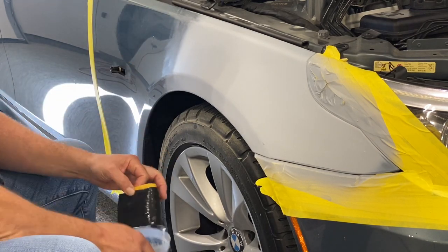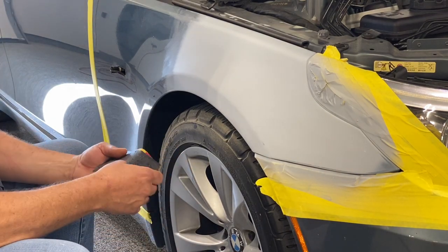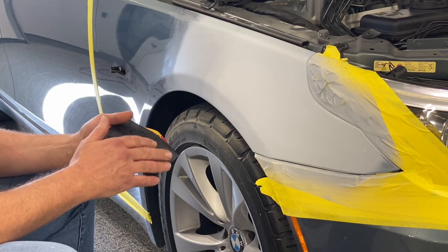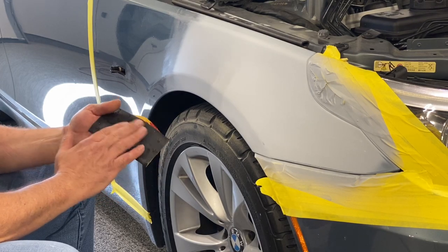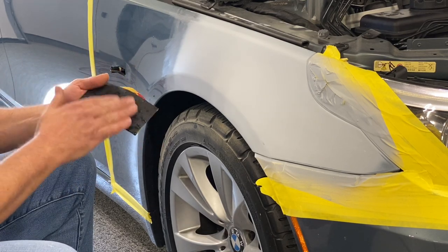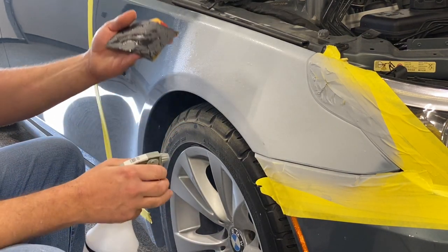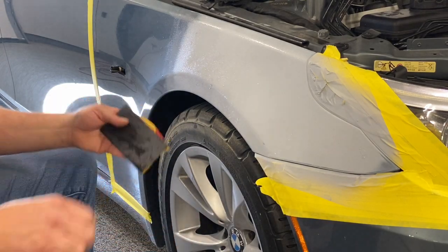So what I've got here is 800 grit wet sandpaper. I'm just gonna use this wet, and plus when you use fine grit sandpaper, like pretty much 800 or finer, it doesn't sand very good unless you wet sand it, because the water keeps the paper from getting clogged up, because that is so smooth and so fine. This is just a squirt bottle full of water, and the sandpaper's been soaking for a while, and that makes it fold a little bit easier is all.